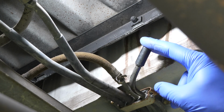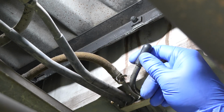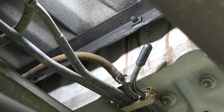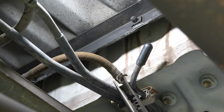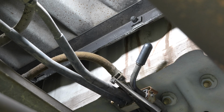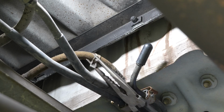See, not bad. And then over the send line, I'm just going to put this little vacuum cap I have over it, and what that's going to do is prevent dirt from getting in there and getting in the fuel injectors. So it's a good idea, and link down below in the description to them. And then we can just kind of sneak our needle nose on this hose clamp and walk it backwards off the barb. There we go.